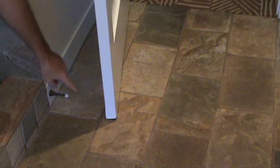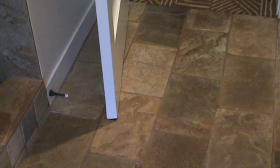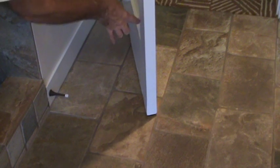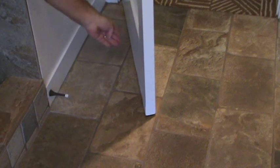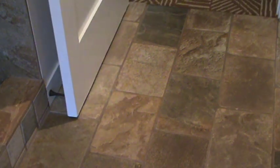With a trained eye, of course you can see it. I can see where it's been lifted up from before and all that. But the main thing is that that repair is going to last probably for a couple years at least, until all the other areas on the door start separating. Remember, there's a bulge over here — that's just going to get bigger and bigger, extend out further. Once it breaks that skin, there's going to be a big patch there. You could probably patch that with something, paint it, and go a while longer for your door.